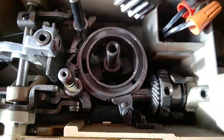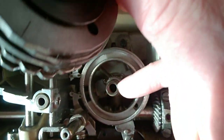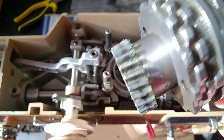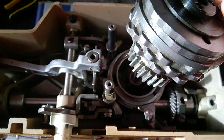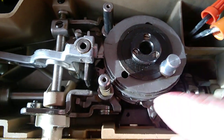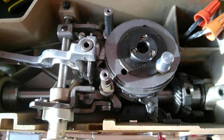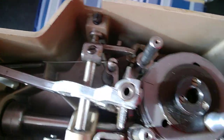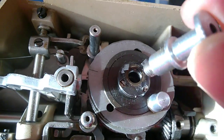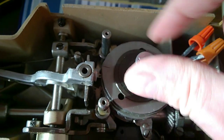and we have one of the 2 gears. The other one is more difficult to see, it's on the shaft here. It's right here, there's not enough light, you will see it on your machine. So again, a tiny coat of grease on it, and when you drop it back in place, don't worry about the timing. If you don't disassemble the disc, the timing will be perfect. You won't have a problem with it. So be sure to just slightly tighten snug this small knob when you put it back in place.